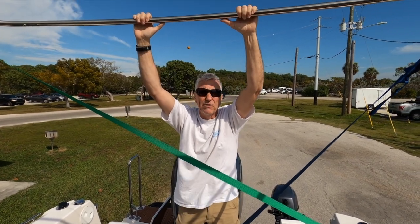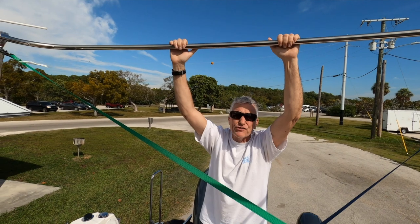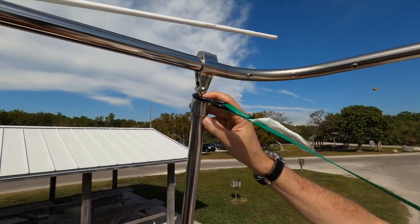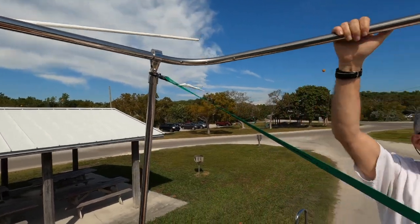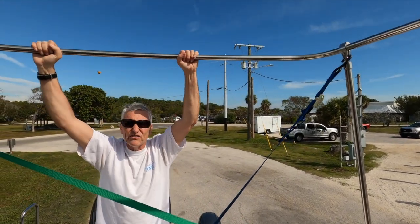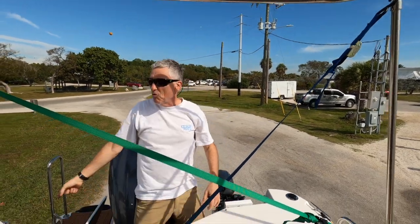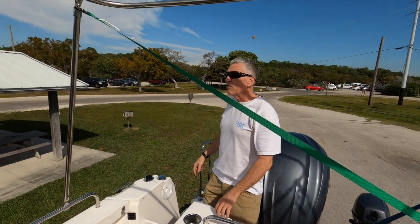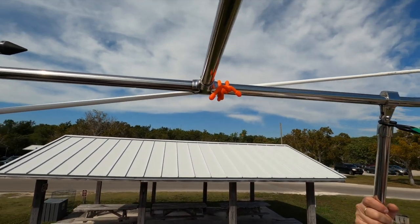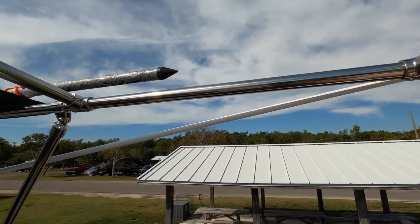This is the frame for our canvas top, and it's pretty fragile — there's a lot of play in it, it can jiggle side to side maybe six inches. Over time that might cause nuts to come loose or even break. So I added some straps to hold it in place. The important thing is not to over-tighten — just enough to stop movement. I've also tied down my antenna up here using one of these twist ties. As long as it's not moving, it's not wearing.